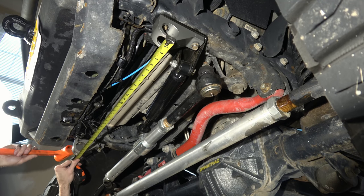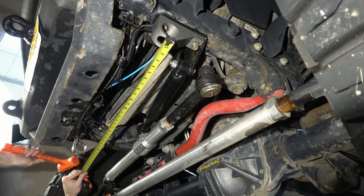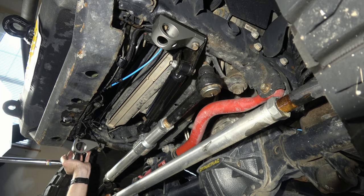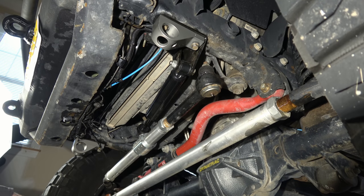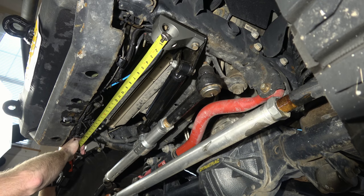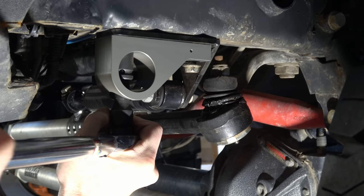I'm going to go ahead and put some thread lock on the front bolt, but we are leaving the rear bolt loose on both sides just for that final adjustment — it'll make it easier to get the torsion bar into the bushings. Now I am taking a measurement here, and here's why: the system is designed around a 31 and 13/16 inch outer dimension of those gray frame mounts. The closer you can get to that measurement, the easier the rest of the install is going to go — the spacers and all that come with it are designed around that.